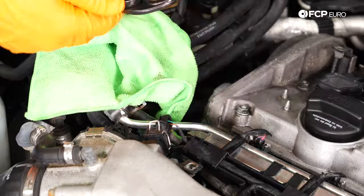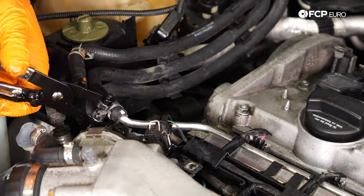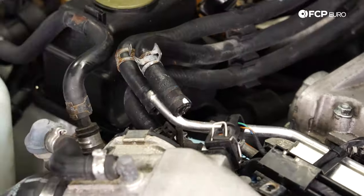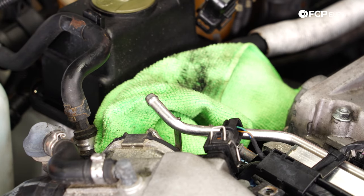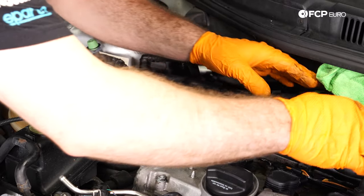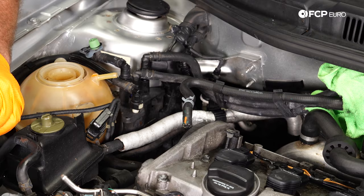Just a heads up — these are fuel lines. Always do this with a cold engine and make sure the fuel pressure is out. There's not really a Schrader valve in this system, so it's a possibility that fuel is going to come out when you release these. I'm just going to throw some shop towels underneath. Just wrap these in a towel because these fuel lines are right above your exhaust manifold. Granted, once you start it up and it gets hot it will probably evaporate, but you always want to be careful.